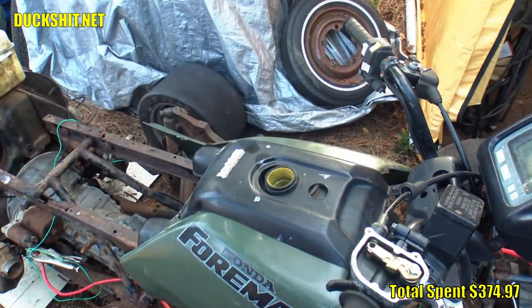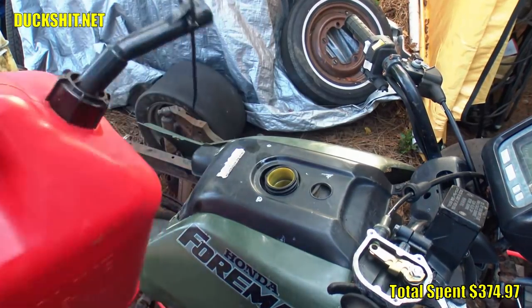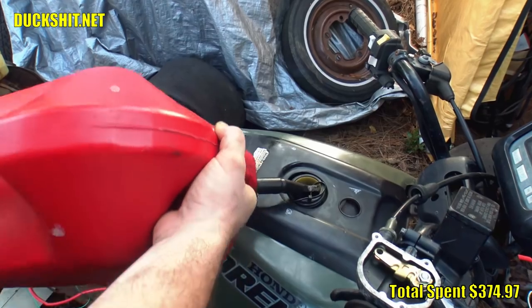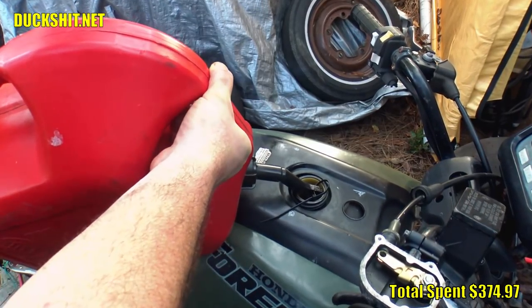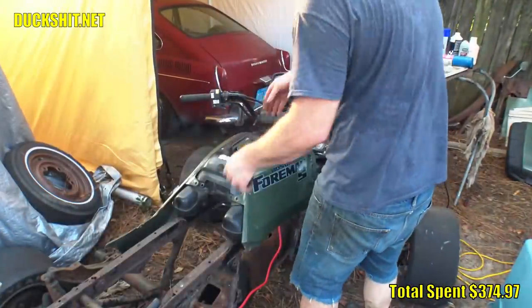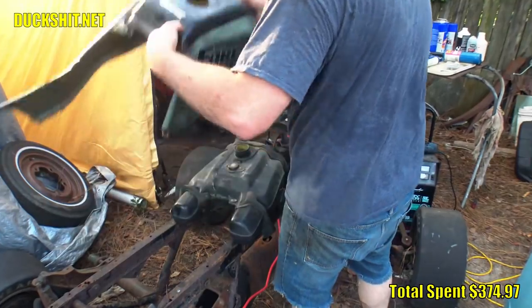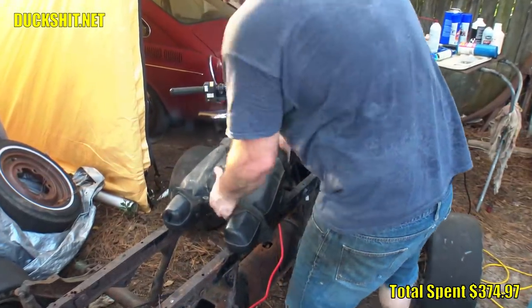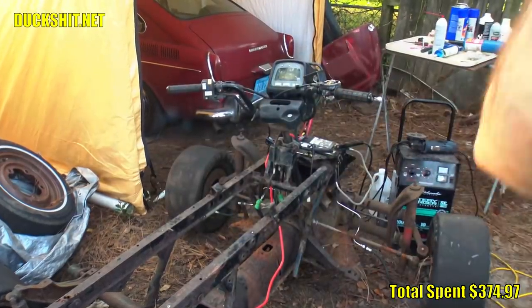In the bottom of a tank there is quite a bit of sludge that stinks horribly and moves like molasses. But this tank is plastic, so no need to worry about things like rust. The best way to clean it may be to soak it with about half a gallon of gas and just shake it up. After all, it's already gas that's in there, even though it's rotten and nasty. It stinks! I can't think of anything better than just adding a little more gas that will do the job quite so well and of course won't harm the plastic. So with that said, I guess we'll let it sit overnight and see what happens.